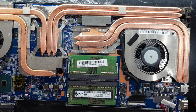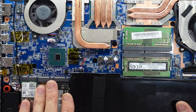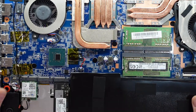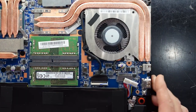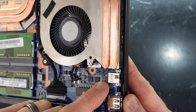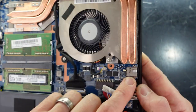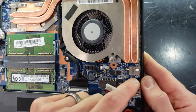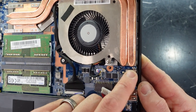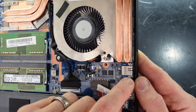With the battery disconnected, you're free to upgrade your NVMe, replace your wireless card, or change your RAM. One thing I noted from a repair standpoint — the charger port looks extremely similar to ASUS model charger ports. It looks like you could get away with not having to physically remove the board to replace it, as long as you can get hot air in at the right angle.